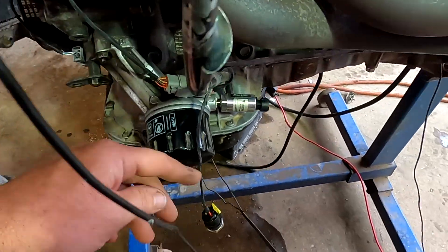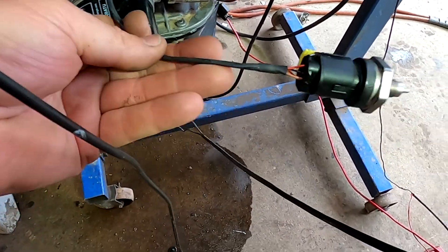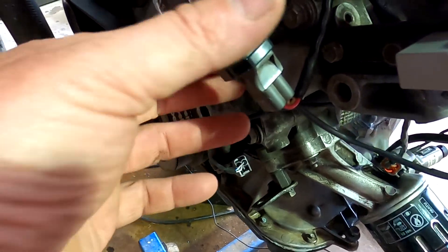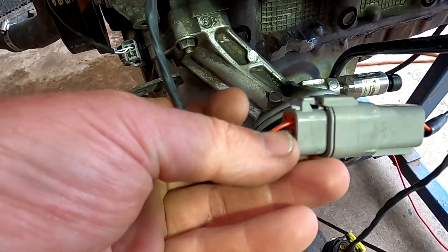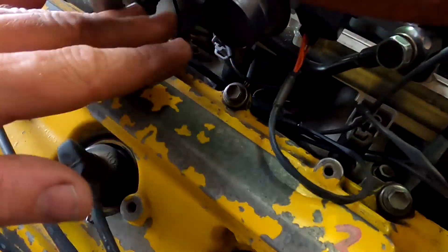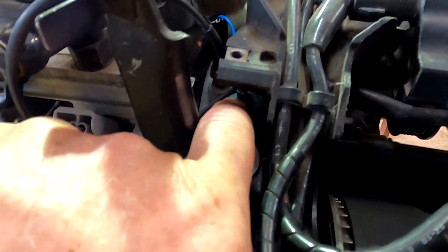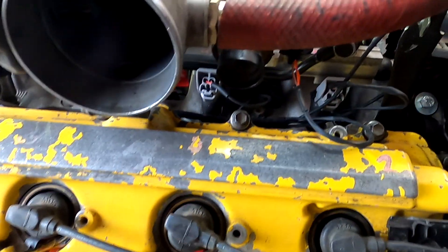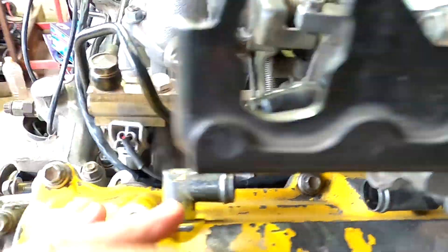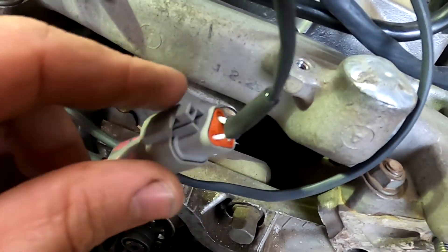With that, it can be upgraded to a sensor which has got pressure and temp — we've gone in and tested that both those circuits actually work. It comes down here for your crank angle sensor and your cam angle sensor, and in that plug I've also got a spare wire if you want to do air conditioning. On this side: throttle position sensor, the injectors, coil, temp sensor for the dash, and temp sensor for the ECU. Cold start is not connected — that can be deleted. Air temp sensor we generally fit in the throttle body like that — got other videos on that.